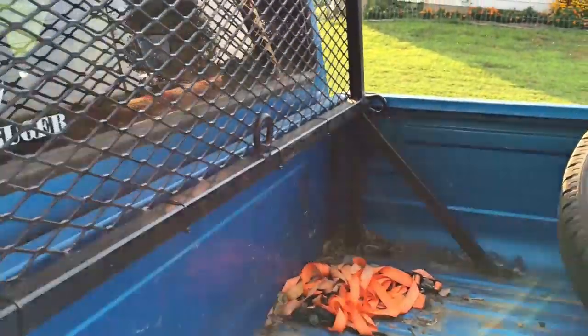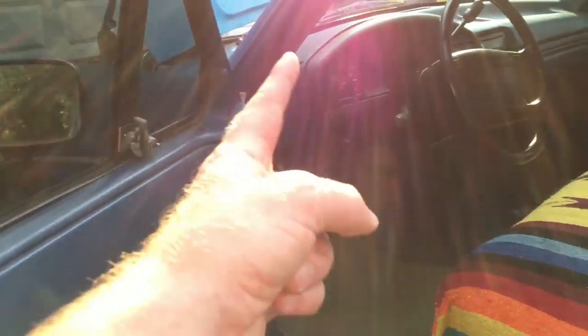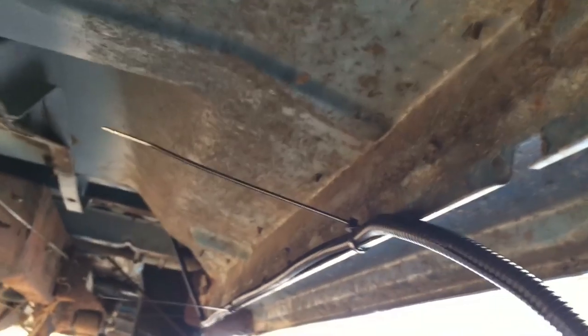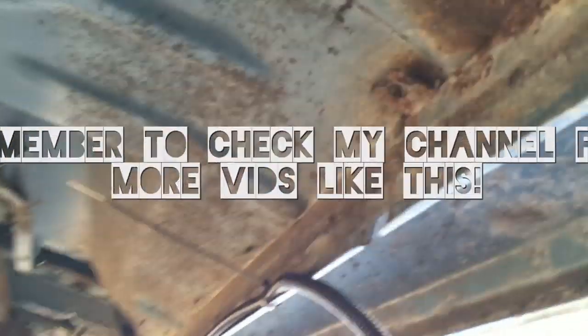I got all the wires over there in tubes and they're tucked all the way down. This side meets up with it here. Now I've got all my excess wire. I'm going to run all the positives up into the truck and to the switch. The negatives I'm going to run up into the engine bay straight to the battery. Then I'll return with the positives from the battery back to the switch, just running the line along the frame — it's got places I can zip them in.